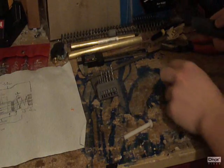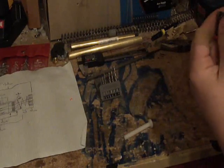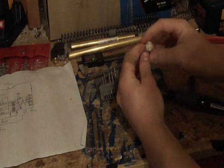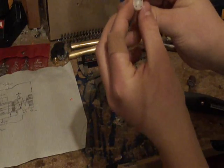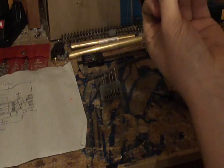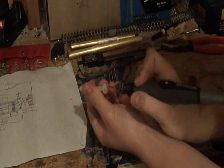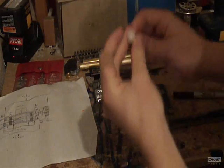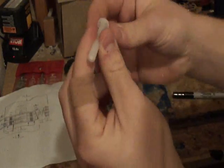For the next step you're going to need some drill bits. I'm going to use a 5/64ths-of-an-inch bit for my Dremel. On the end that you just glued, where all these black marks are — they are between the half-inch nylon and the three-eighths-inch nylon tubing. You want it to go all the way through so air can pass through. Go ahead and drill out each one. Once you're finished drilling, you'll end up with some holes — they don't have to be really precise, you just want air to pass through, and as you can see it goes through both sides.